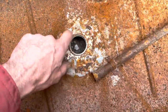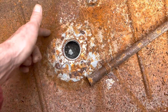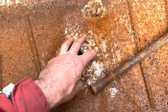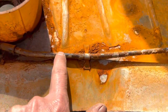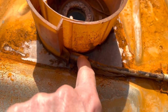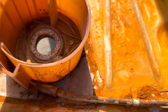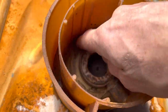This here is the fitting that the fuel sender drops into — we could potentially remove this and drop it into our tank. This is the fuel return line fitting, which on this tank is broken off. It attaches to this pipe here which goes all the way into the venturi via this little plastic hose, which often detaches itself so that your fuel return is not actually going into the venturi. The venturi itself is held down by these three clips.